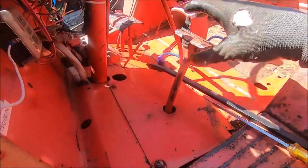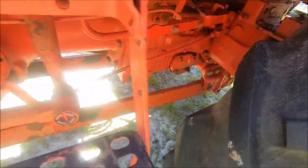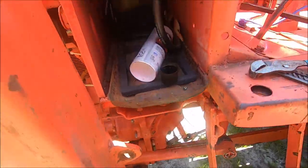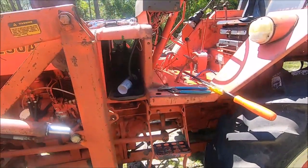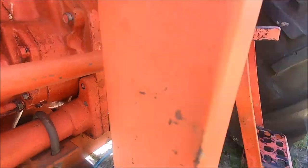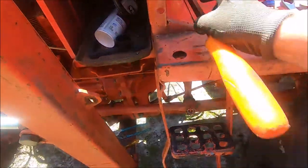Before, the clutch pedal was a little mushy and wanted to stick down. There's a little bit of range there but now we've got a nice spring back. It's also engaging the full stop down there — that's all the way down to the floor. There's still a little bit of slop in here, and what you want is a little bit of free play. I don't remember what the free play spec is, but this is a worn-ish clutch so it's old. I'm going to take out a little bit more free play. Just a little bit of free play there where we actually disengage our clutch.